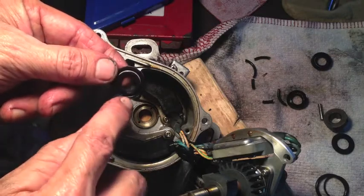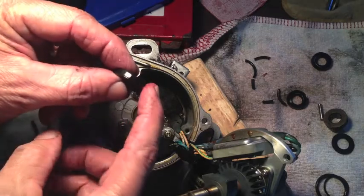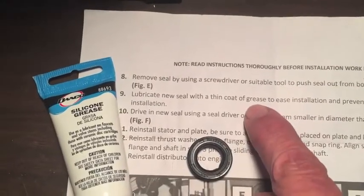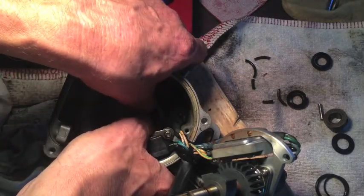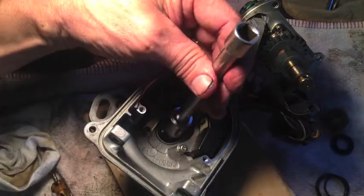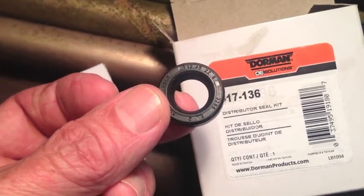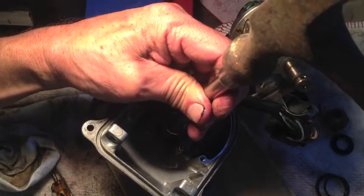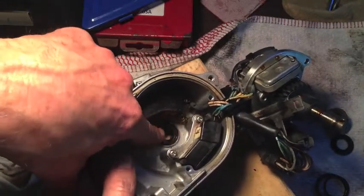See that little silver spring that goes all the way around in that little cutout — I want that side to be down. That's how the old seal was installed. I'm going to put a little bit of engine oil around the outside to help it slide in easily. I put engine oil on that seal — I should have put grease; I hope that doesn't hurt it long term. Put it down in there as flat as I can get it, trying to put equal pressure on each side. This is a 15mm socket, which is very close to the same size as that new seal, so I'm going to place that right on top and press it in. That looks like it's fully seated — it's even all the way around, so I'm going to go with that.